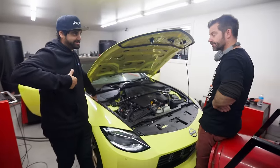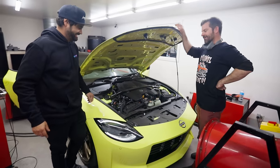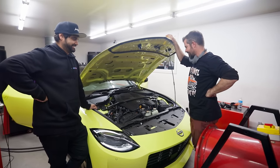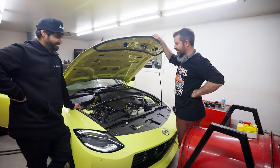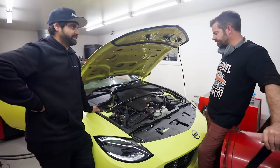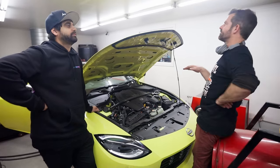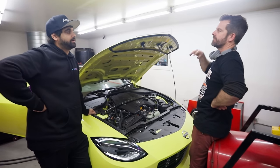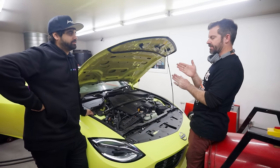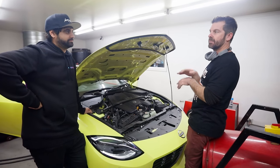We've got Crackle Tune, Instant Headache Tune, and Bubbly Tune — all the features are in there. It's also got launch control, we're just screwing around with that at the moment. The neutral rev limiter was at 4,000 RPM — it's now at 7,000. Top-end limiter is at 7,000, and instead of a 300 RPM hysteresis on the limiter it's now 100, so it should sound a bit quicker and snappier.